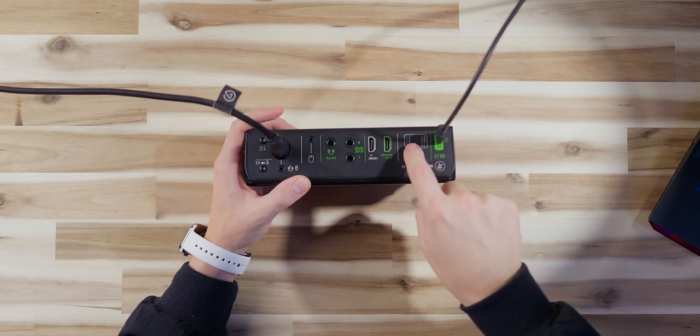Something you should know: even though one input is a 10 gigabit USB port, this port is only 5 gigabits. So yes, you could plug an HDMI 2.1 capture card in here, but you need to make sure you're not maxing out the 5 gigabits per second bandwidth — especially if you're also using the camera capture. You'd probably have to turn down the capture to 1080p60 max. Just know that 5 gigabits per second is the maximum bandwidth there.